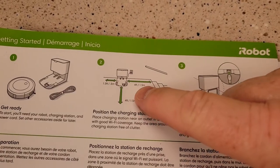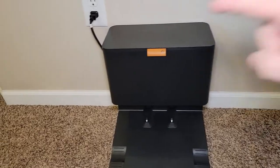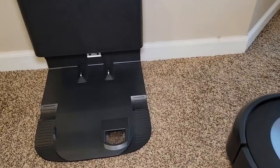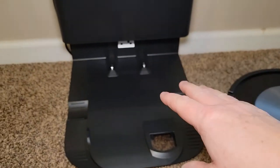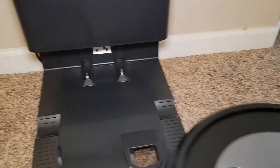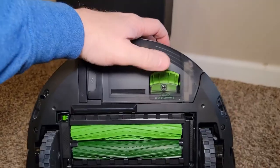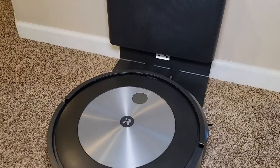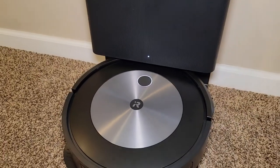It says to talk about positioning the charging station — make sure it's not too close to stairs, and you've got some room in front of it and to the side. I've got it plugged in; it's only a two-prong plug. There is no power switch. The robot is going to wake up whenever we put it on this base unit. Make sure the base unit's plugged in. This eye right here, we're going to point that towards the charging station, and there's a little groove for the wheels. As the vacuum fills up, it's going to come over here and suck all the debris out. As soon as I put it on the base unit, that light comes on and is steady.